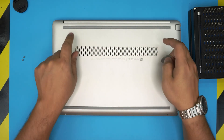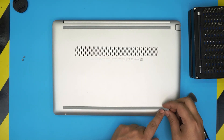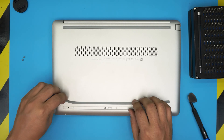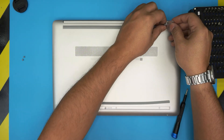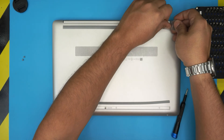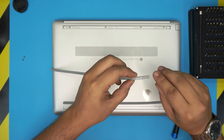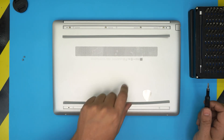On the bottom and back rubber strips there are hidden screws. To remove the rubber, stick the opening tool in the bottom corner and lift it up at a 45-degree angle — don't yank it sideways or you'll crack the rubber. Pull it up slowly. There's a screw right underneath. Do the same on the back end. You can reuse the adhesive later to cover the screw hole.